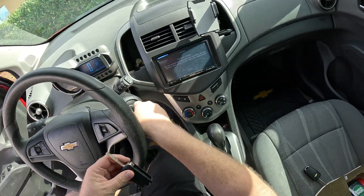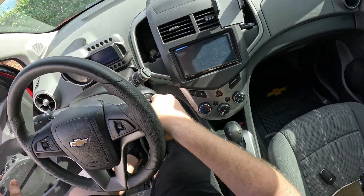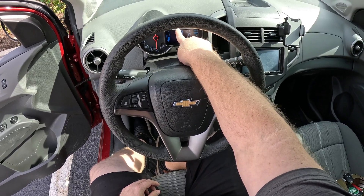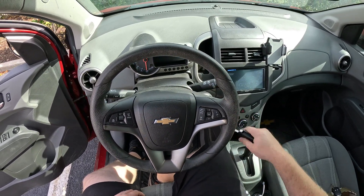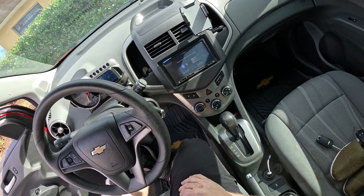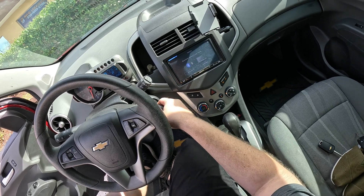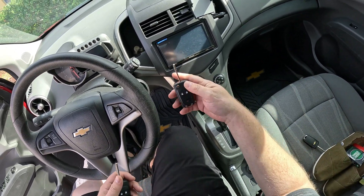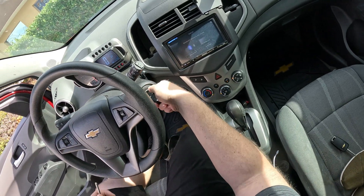Within five seconds, put the new key to the ON position and the security light will stay lit for five seconds then turn off. Within five seconds you can put the third key and it's going to register it. That's onboard programming. Now the car will start — you can see the gauge coming up. We're going to test all of those keys and they all work the way they should.